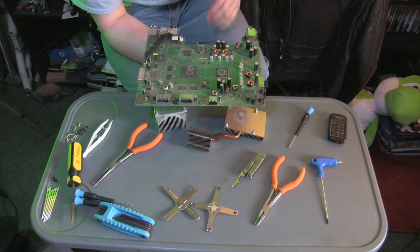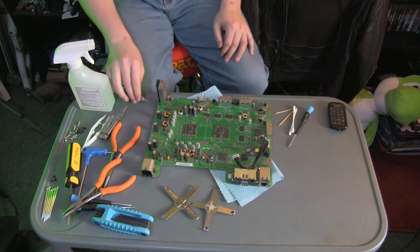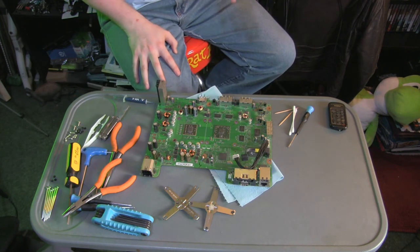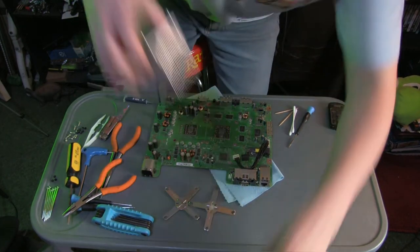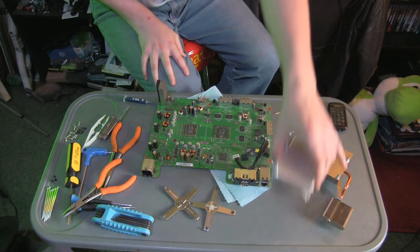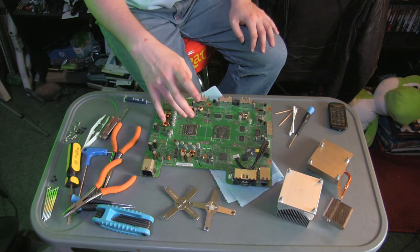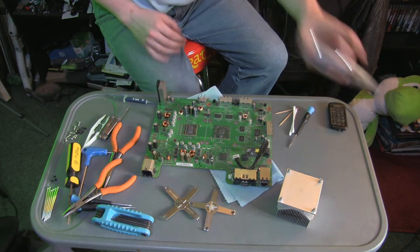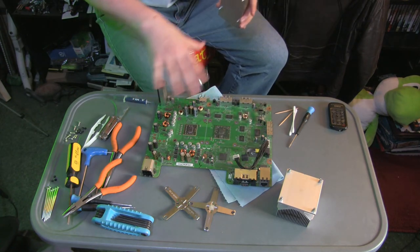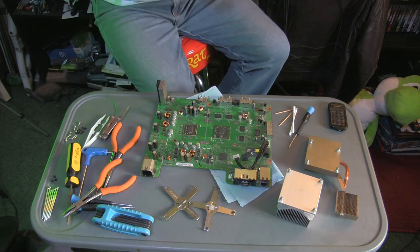Clearly it's a good thing I did this. We're going to clean this off, put on new thermal compound, and that should make this system much, much better — also blow off all this dust. The old thermal paste was so hard, it was barely moist. I cleaned up the two heat sinks and now I'm going to reapply them. I'm going to work on one heat sink at a time so I don't have to worry about making a mess. Got my MX-4 thermal paste ready.